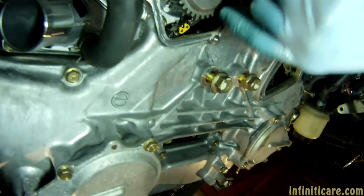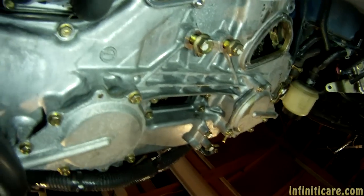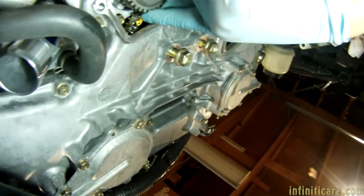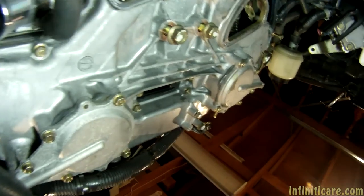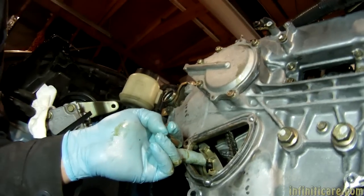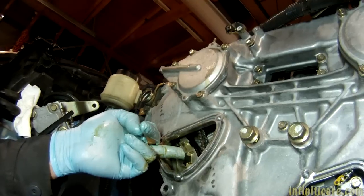See there's that groove in there — you want to make sure the chain is in that groove. There are multiple grooves; you want to make sure it's in all of them. The chain has a shoulder — it has to sit right in there. If you pull the chain back and forth, try to move it, you'll know if it's seated. Now that that's there, we're going to hold this and start cranking the motor back, keeping pressure on this side.